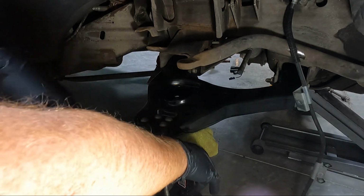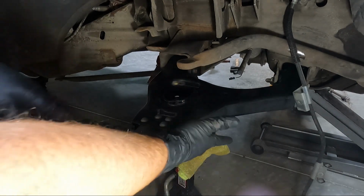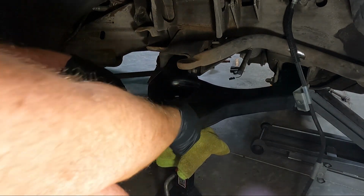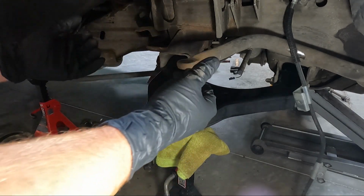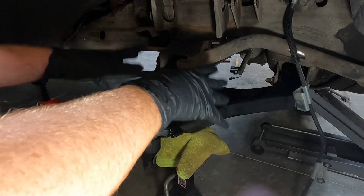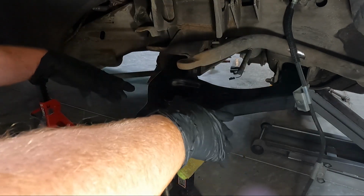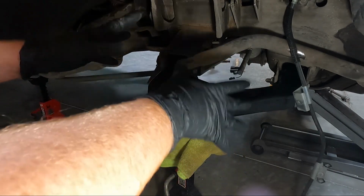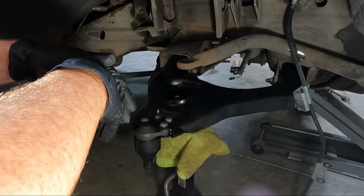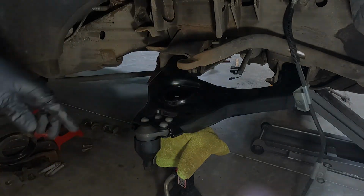and we can technically take the jack stand out from under it. I probably won't, but you can at that point, because the suspension will be loaded. As you put weight on it, it will move, but we don't want to lock it down with it facing down, and then you get a ton of bushing noise when you're going down the road. So this is the way you need to set it up. Go ahead and torque it, and then we'll move on.